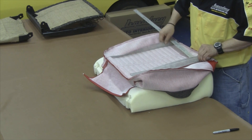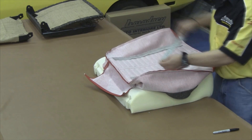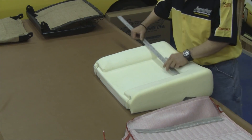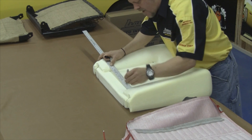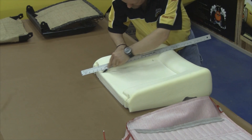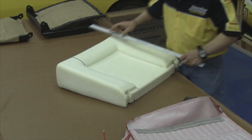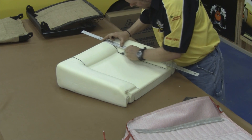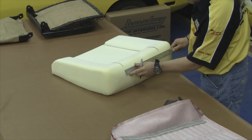Our next step will be to adjust our molded foam kit. This is a universal foam kit that will need modification. We want to measure the width and length of the insert or the recessed area and duplicate that on our molded foam. We do that by finding our center point of the molded foam and measuring out the distance, which is the same distance as the listing pockets sewn into our seat cover. We want to draw a line from front to back on both sides. This is the area we'll want to trim off and keep flat so the insert portion of our seat lays flat and the outside collars of the bolsters will be raised up.